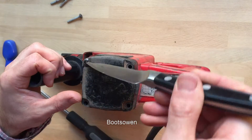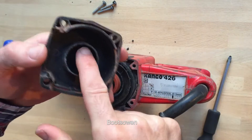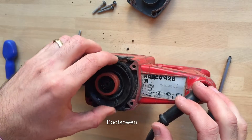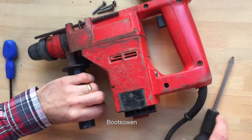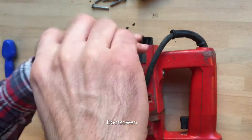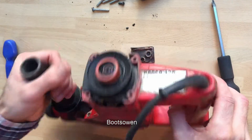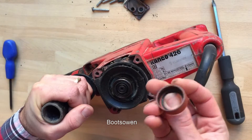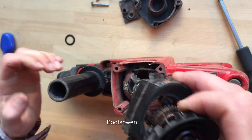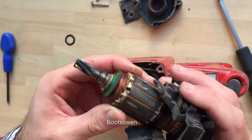There's a bit of clay there from having it left on something. Just rock that upwards — you can see in there there's a seating for the bearing, a rubber seal, and a little bearing there, and then there's this fan. The brushes are in underneath these side covers, held on by another two plastic self-tapping screws. I haven't been in here recently. There are the brushes in there, and these are great fun to try and replace. That's the rubber seat. Just brute force pulls the armature out.